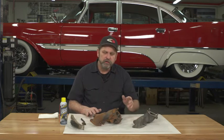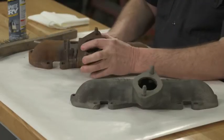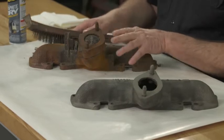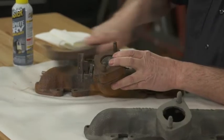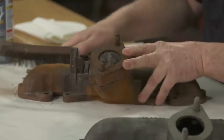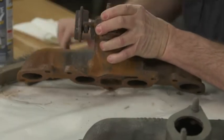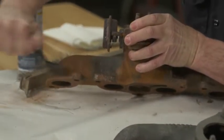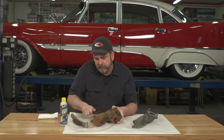You can start by blasting and getting rid of all the rust on your exhaust manifolds, but that's a lot of work and most guys don't want to tear apart their car to do that. So you can accomplish the same goal just by taking your existing exhaust manifolds and wire brushing off any of the rust or loose debris. Most of that stuff will come right off. If you've got some small wire brushes, you can get into all the corners and get off all the heavy loose stuff, because that's just going to end up flaking off anyways.